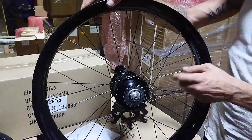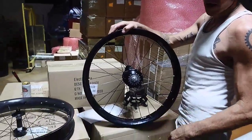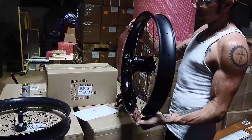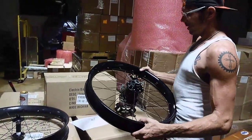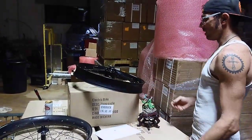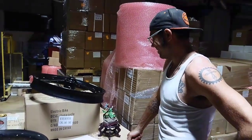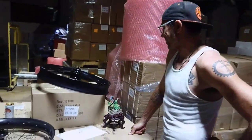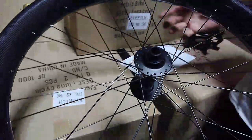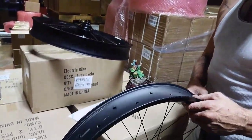It overlaps the hub just slightly, but the flanges on this hub are really strong because they don't stick up very high off the hub. What you end up with is a very stiff, very lightweight wheel that should last an incredibly long time without having to true it much. As for going off cliffs — I think it will do just fine. It depends on how high the cliff is and how good the rider is. You're not afraid of these carbon fiber rims breaking — these are strong rims.